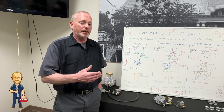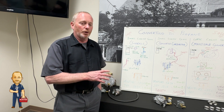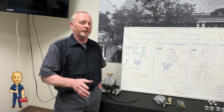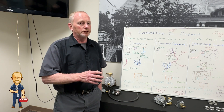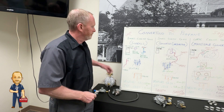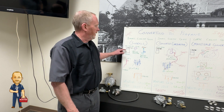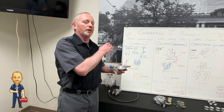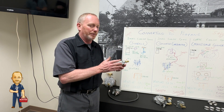You can also use your gasoline and your propane in different areas, so we're not converting it from gasoline to propane — you're going to be able to use both, just not at the same time. We'll go from our propane tank to a small low-pressure regulator, getting it from a hundred pounds down to about five pounds.